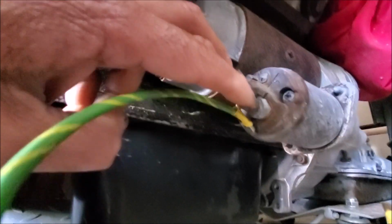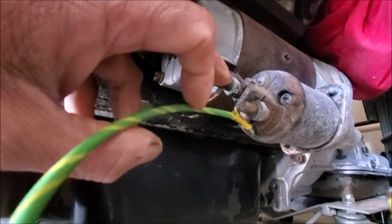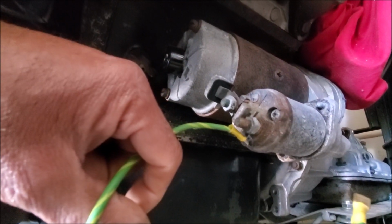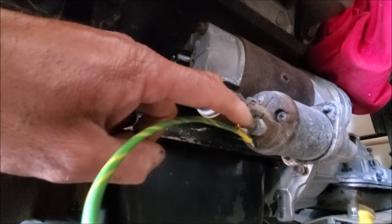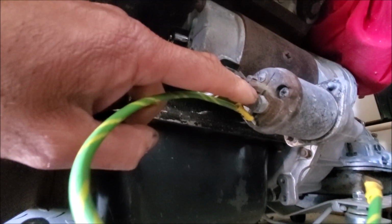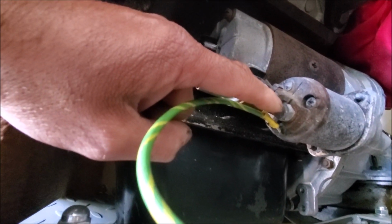As I said, they're very simple to wire up, they're not difficult, but a couple of Triumph folks will sell you relays with wires already connected, so that's something you could do. But as mentioned, you want to be super careful because you've got the direct supply from the battery coming on this, especially on Mark 1, probably Mark 2 has the same thing. It's always live, so you want to be careful when you're working under the car.